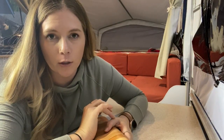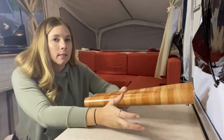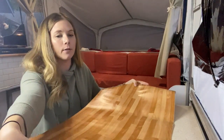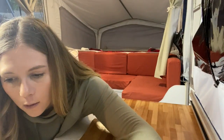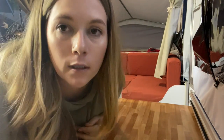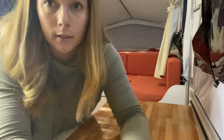Once you have cleaned off your countertop, the next thing you're going to want to do is measure your vinyl. You don't want to have to piece together your countertop — try to get this done in as big of pieces as you possibly can so that they look more natural. You're going to want to measure using the back of your vinyl; there are nice little squares on it. If you like to be as simple as possible, you can just use your vinyl to measure out your area. In my pop-up camper I have a little ledge I'm following across the back, so I'm just going to make sure this is nice and straight throughout the entire process. Once you have it all lined up, your countertop is clean, you have measured, and you have cut.